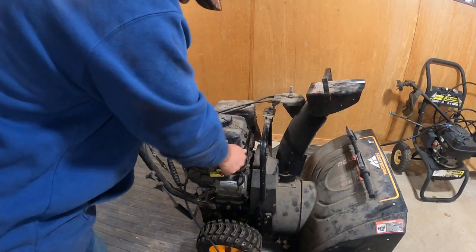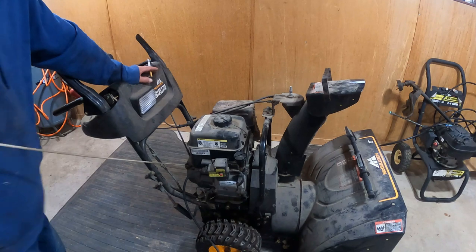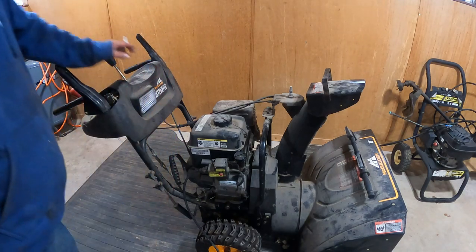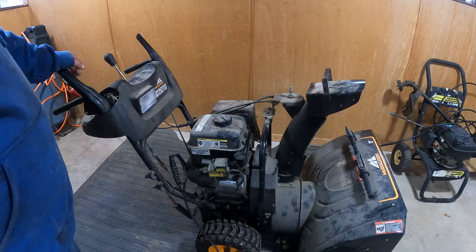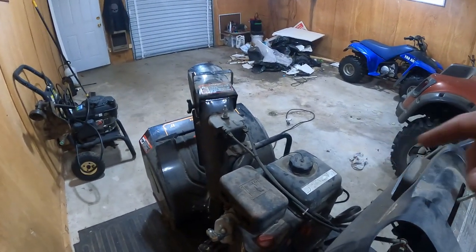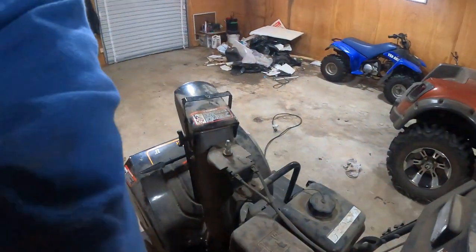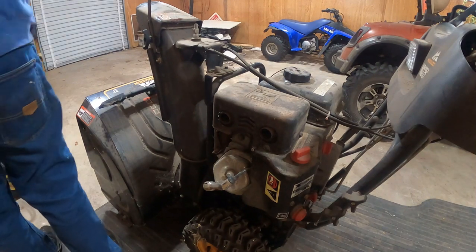I got her filled up with some oil. You hear that clunk clunk? Sounds like a rod. Yeah, I think the oil drained out of it, and she knock knocks. But anyways, let's do a compression test on it. And then that could be maybe the belt down there making noise. I don't know. Hopefully that's what it is. This one?